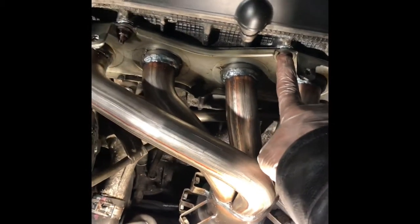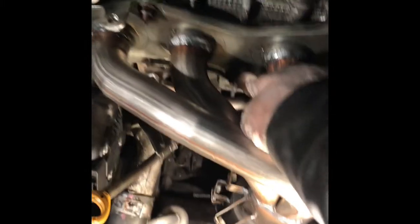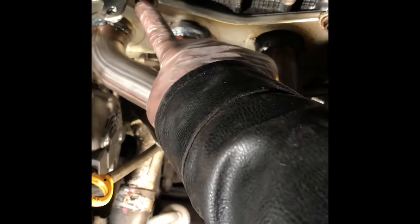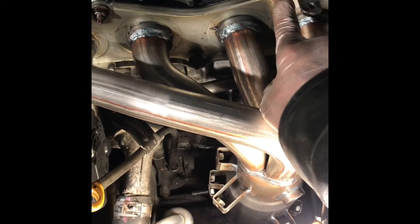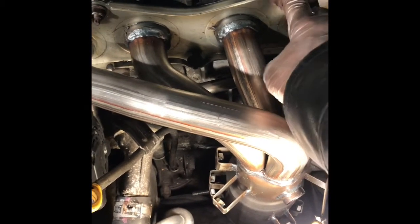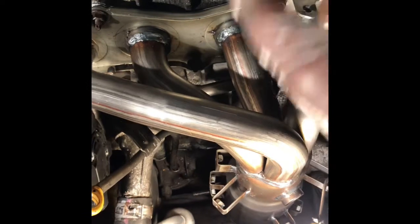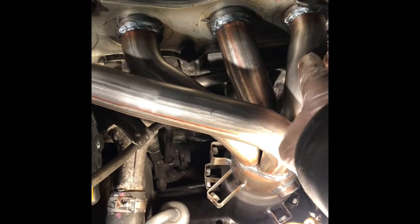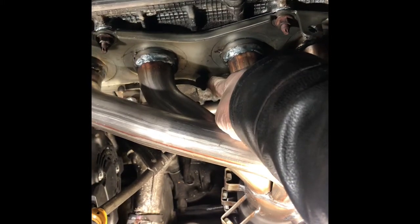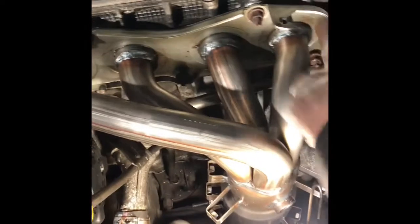Just hand-tighten this, and this, hand-tighten. After that this one and the corner one, then this one. First of all, hand-tighten it, then tighten it — not like crazy. This is the block soft, so don't go crazy. There's a gasket, just feel it like it's tight — you'll feel it when you do that. Tighten by order, like a cross pattern: this one, that one, that one, this one, the corner one — like that way.